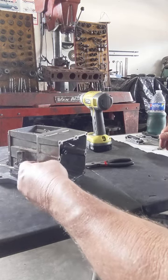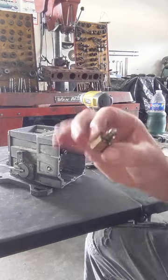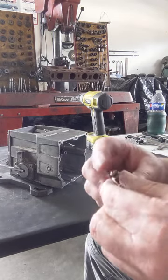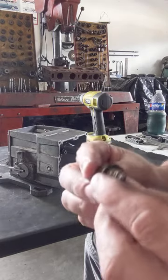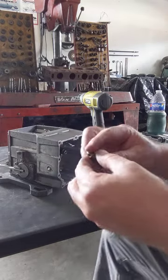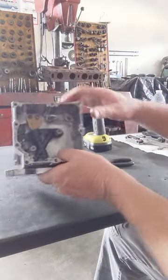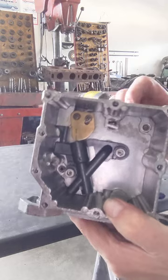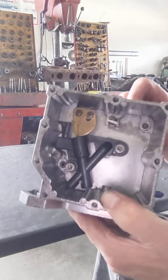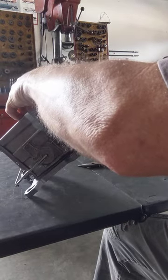Take it out before or after, it doesn't really matter. This is your needle valve or your fuel inlet. It's got a little ball here, and it's a little check valve, is what it really is, from the fuel. All right, now basically that's what you're looking at in there. Now you're down to a spool and a cam. So next, I'd go ahead and take this cam out. Two screws, usually Phillips.